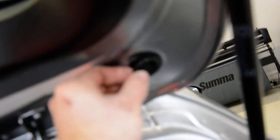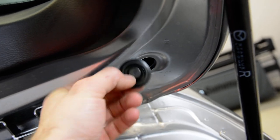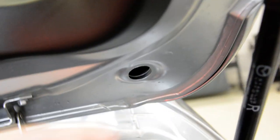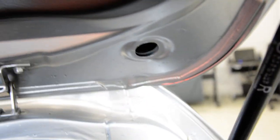After removing the third brake light, you will have four screws. Here you will have a plastic cup — remove it, and under this you will have one screw. It's a 10mm screw, and there are four of them.